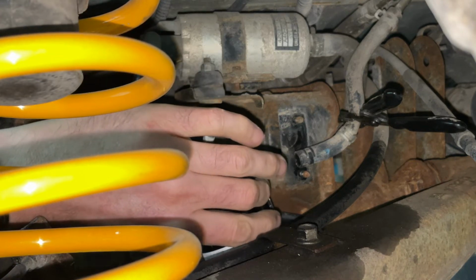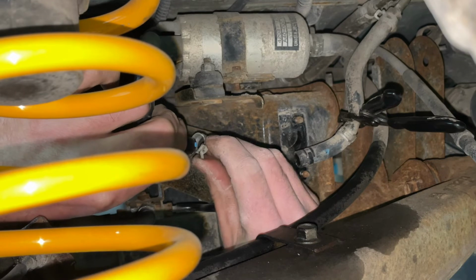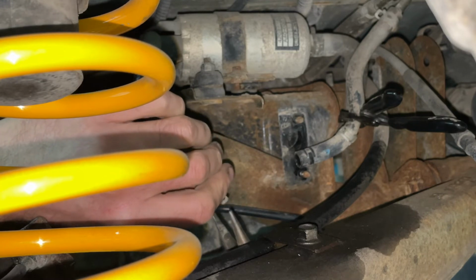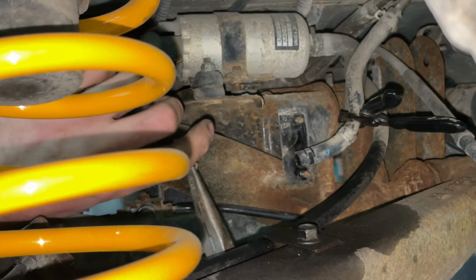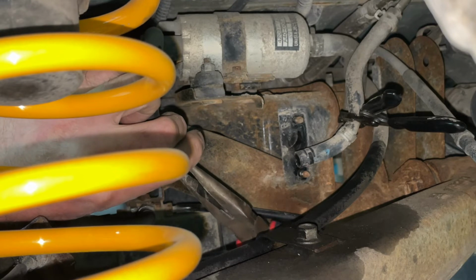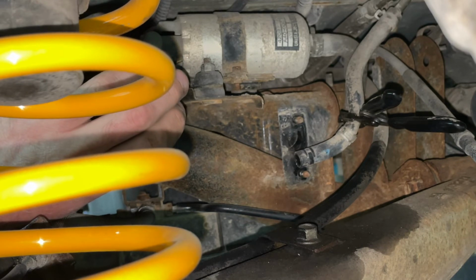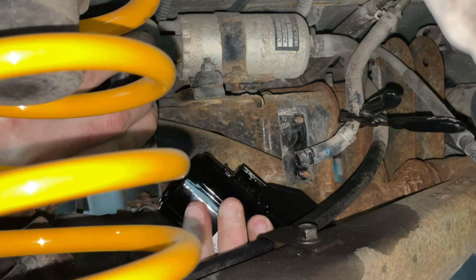So it goes on the same way. I'm gonna need that clamp first. Oh man, it's gasoline. I did put a little bit of assembly lube, like the white grease, on the nipples, so it will slide in a little bit easier. It's okay, it's made for new engines, so it'll just dissolve in the gasoline. Use it for injectors and that kind of good stuff. Okay.